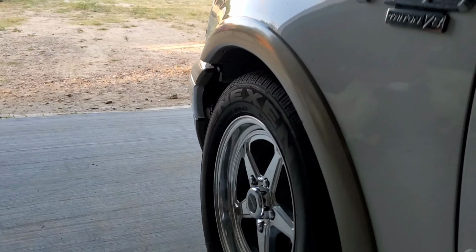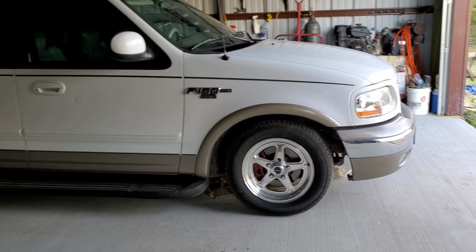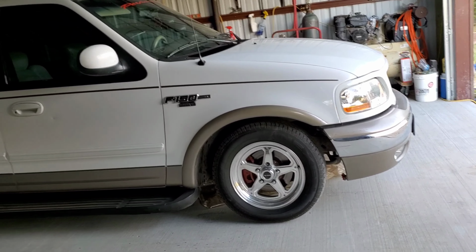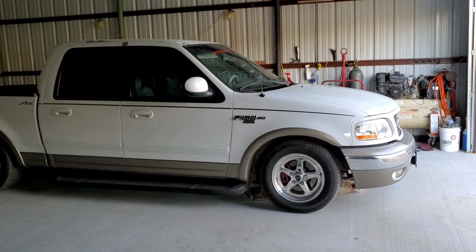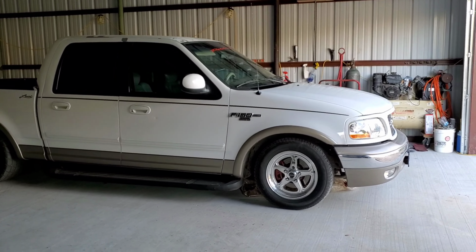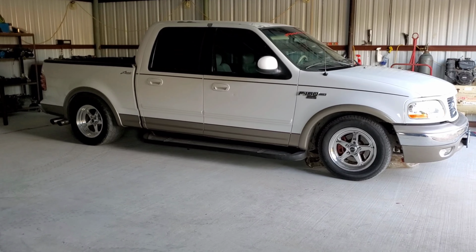If you wanna do a complete, perfect alignment on them, you've got to get the 4-6 drop that comes with adjustable upper control arms, or the modified upper and lower control arms, and you'll be able to do the alignment excellent. With a 2-4 drop, it's the 2-inch drop springs, and on the back the flip, so you won't get as perfect an alignment, but it's going to work. It's not going to eat your tires through the inside. So man, I like the way it came out. I love it. What can I say, guys?